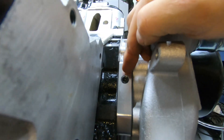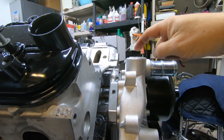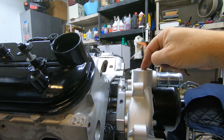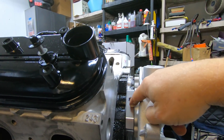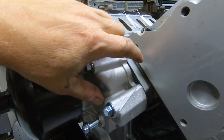What's nice about these spacers — look at that, it always has a port. What do you think you put in that port? You can put your water temp sensor in there, or you put your crossover tube in there as well. There are different things you can put in that port to help out your conversion. Typically what I've done in the past: in the top I've drilled and tapped it so you can run the crossover tube output up there. I've also put my temperature sensor up there as well. This spacer is already drilled and tapped and set up to go.